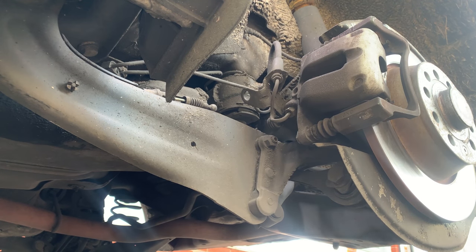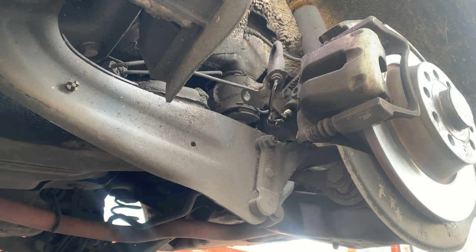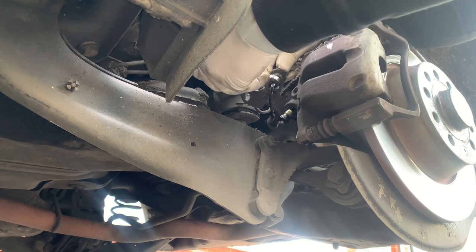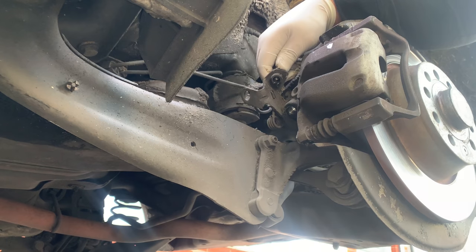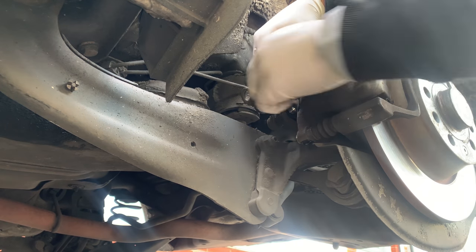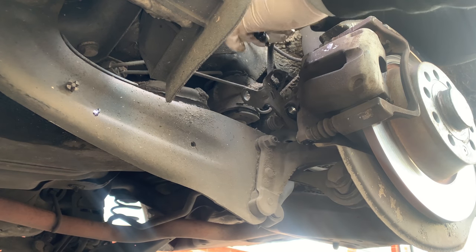Let me get a bucket underneath as well. We'll have to remove both fittings — the top one looks like 11, yeah it is. We need to remove both of them otherwise it won't go through the hole. So we are going to remove that. I'm going to fit it back in so we don't get any air in the system. I use the nipple rubber cover and put the other end in so it stops leaking — that's what I do.